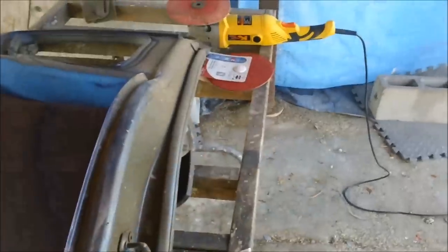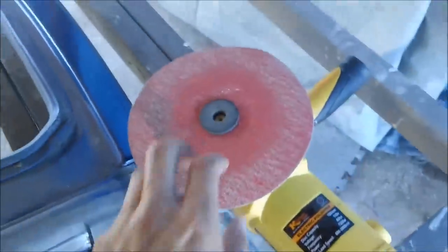For mechanical stripping, you can use 36 grit or 80 grit on your rotary buffer. There's also a 3M system — it's like an 80 grit equivalent stripping disc that works pretty well, and they have a little red Scotch-Brite pad that cleans up the metal and puts about a 320 grit scratch in it. I've only used it once; it works great but this way is cheaper and more readily available.